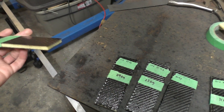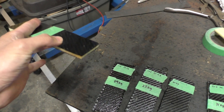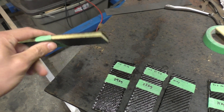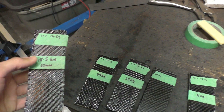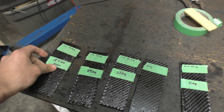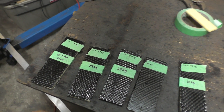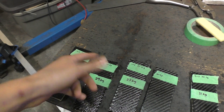The bodywork is going to be clamped to the chassis from one end and the aerodynamic forces are obviously going to try to bend it from the other end. I need to make sure the material is strong enough to not bend under whatever forces it's going to be under. So for most of the bodywork I'm going with one layer on both sides, but for parts that actually do need to be stronger, I'm going with two layers on one side and just one layer on the other side.